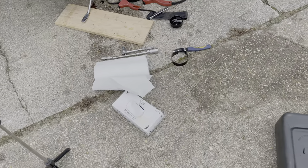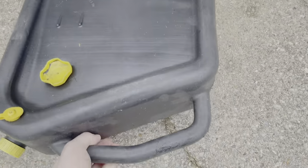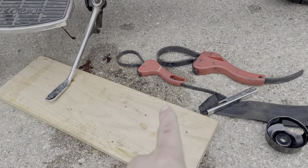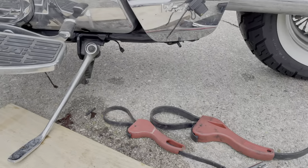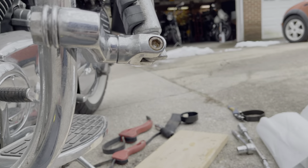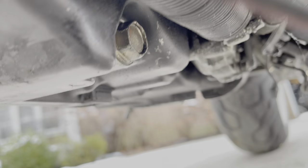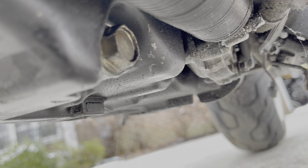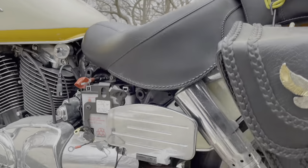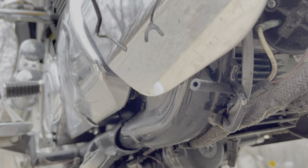Four quarts of oil at draining. Here's all the tools I need: besides a drain bucket, you need a 17-millimeter socket and some oil filter wrenches. The drain plug — I believe this is a liquid-cooled motor — it should be right there. You can see it right there, pull back on the left side of the bike. And the filter is behind the kickstand right there.